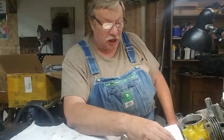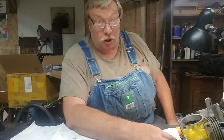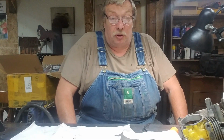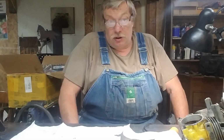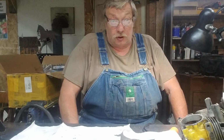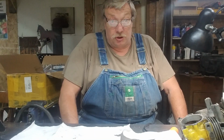I know some of you guys don't like seeing what I do to transfers. If you would run that saw after I've done transfer work only, you'll see what the difference is. And we have done that. We've done the intake and exhaust numbers, run it a while, pulled it back apart, checked things over, and went hog wild in them transfers. On the lower transfers, not the transfer opening into the cylinder. I'm pretty stingy with that.